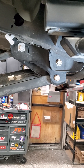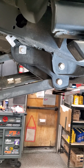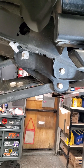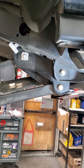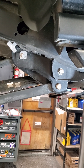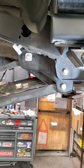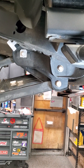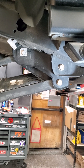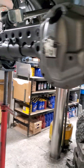The drawback to this is obviously ground clearance — you have this thing hanging down, and if you do a lot of trails and rocks you're going to get hung up on them. Ironically, AEV developed this a long time ago, and all the other companies picked on AEV and said those are dumb, that's a crappy design. Well, here we are in 2025 and just about every company makes a geometry correction bracket now for a JK or a JL/Gladiator — not too bad of a design.